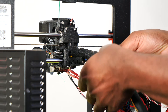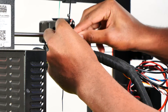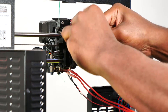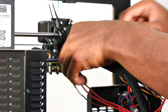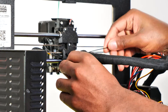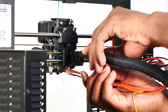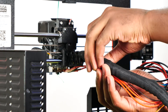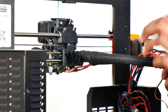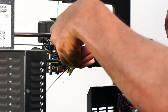The first wrap should be slightly longer than the cable holder — about five centimeters. I took three zip ties and inserted them into the lower row of the cable holder, tightening them slightly off center to the left and cutting the ends as close to the head as possible using the pliers. Next, I placed zip ties through the upper slots on the cable holder, added the cables from the hot end using the channels at the bottom of the X carriage to arrange them properly, tightened the zip ties, and cut the ends close to the head.